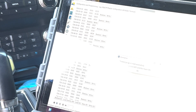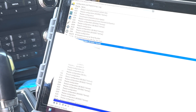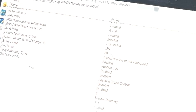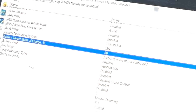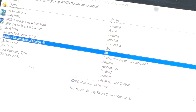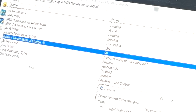There is no write button next to this line, so I clicked the write all button at the bottom and confirmed the change. I followed the prompts and moved to the standard BCM configurator. You'll notice that it says incorrect value or not configured in the plain text configurator — this will pop up on any coding that isn't normally permitted with your vehicle, like turning off your daytime running lights. I also changed the battery state of charge to 90 percent, but I ended up changing it back to 80 later because I wanted to ensure the life of the battery.